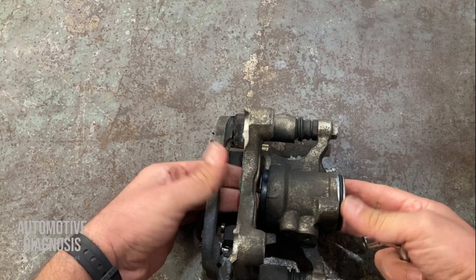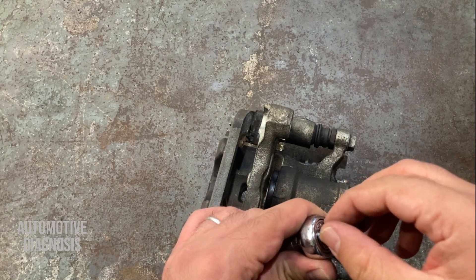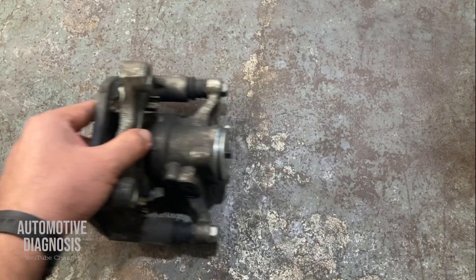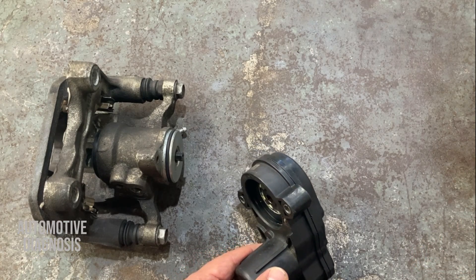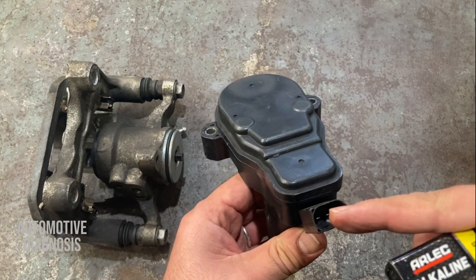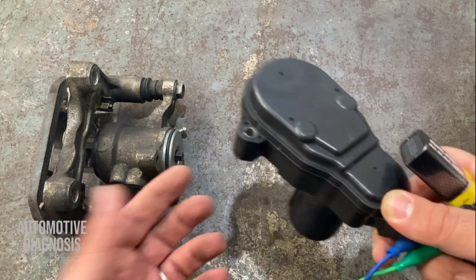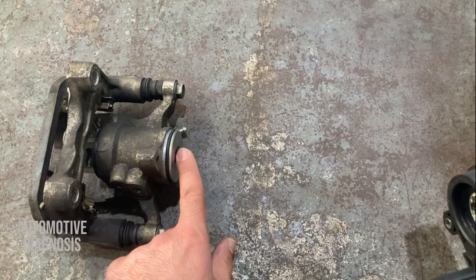You can see there's room for the actuator to go back when turned counterclockwise. After replacing the brake pads, to reapply manually just turn it clockwise. So to summarize: the first way is using the scan tool; the second is providing battery positive and negative on the actuator terminals to release and reapply; and the third is removing the actuator itself and turning it manually.